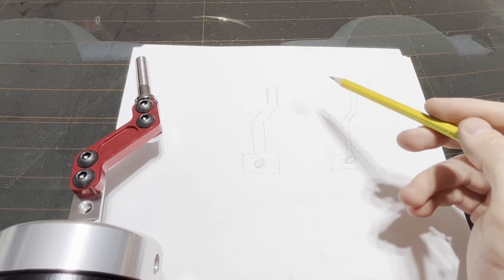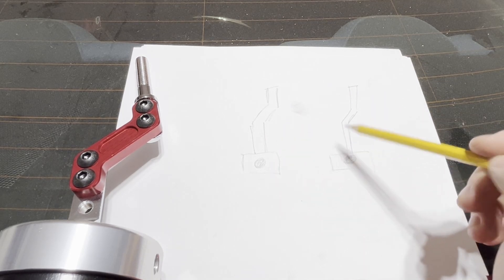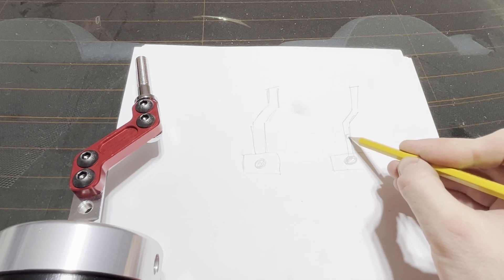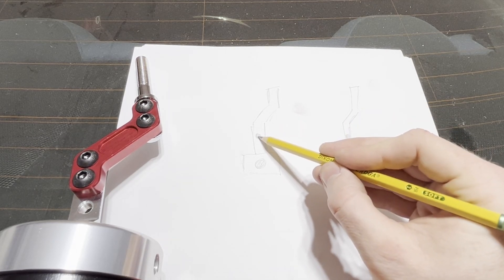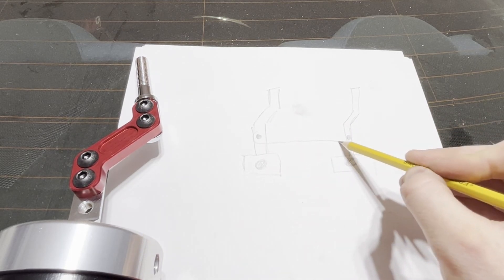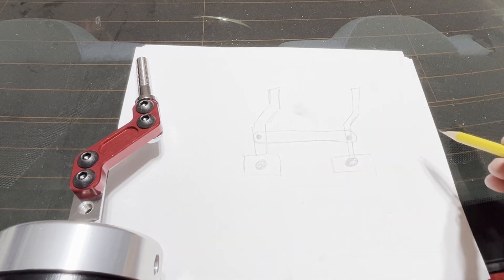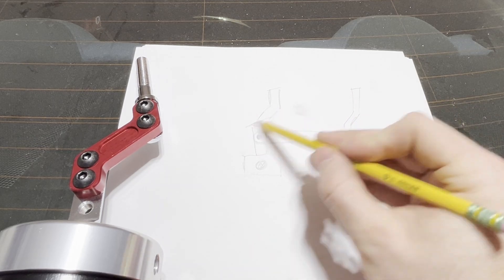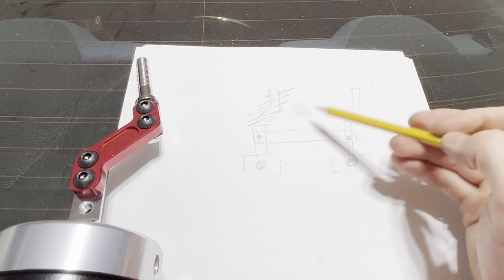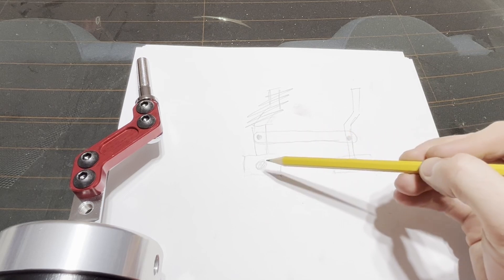So the idea — if you can imagine my poor sketch here — is that both shifters are going to have the same pivot point. Theoretically, if you put a linkage that can pivot at the same height, your angles and geometry should work out very well, giving you a very smooth shifter feel. You'd have a solid linkage connecting the two, and this end would get chopped off. The Mustang shifter would be in the stock RX-8 location, with the AR-5 shifter connected to the transmission.